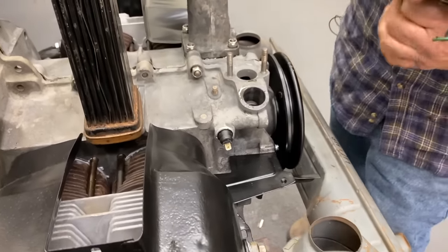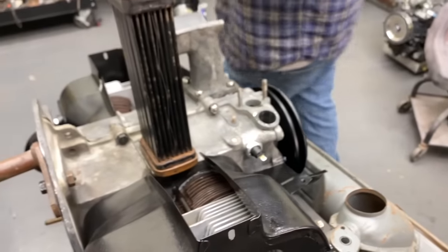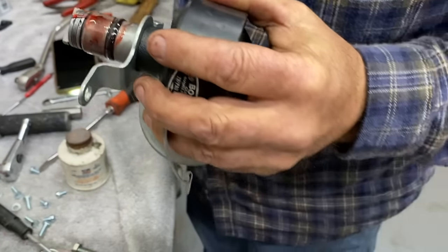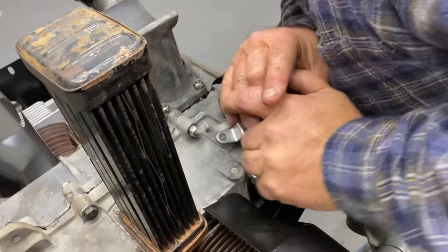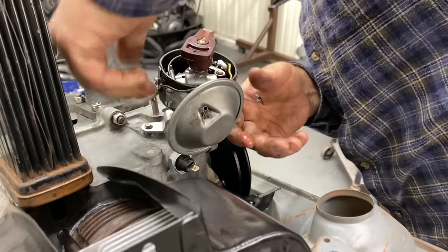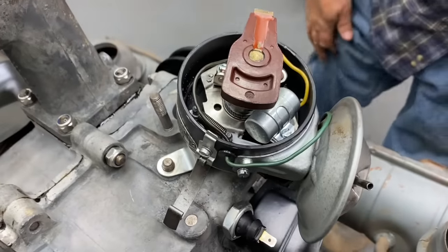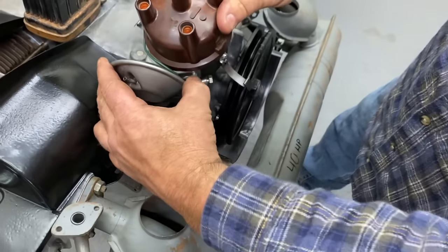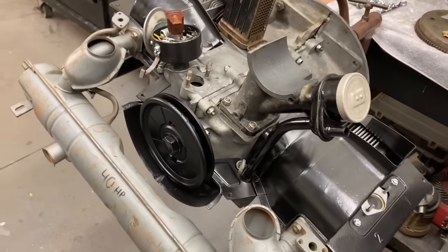And now we're going to put the distributor in next. I'm going to lube this O-ring up because it's nice and tight. Lube it up a little bit. Yeah, it's brand new, so it's really tight. Yeah. She's tight in there. Oh yeah, real tight. Awesome. So here we go. Number one, distributor is where it's supposed to be. Number one's right there. Here's our number one hole, right on number one, and then we have plenty of sweep both ways for retard and advance. Okay. So there, cool. We go. That's that. We'll put a nut and a washer on that and bolt that down.